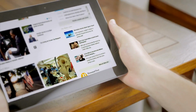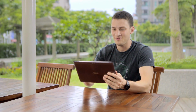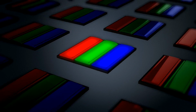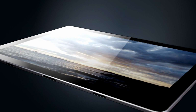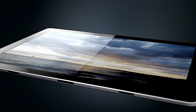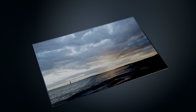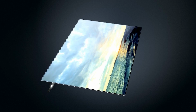Naturally, we wouldn't consider a tablet mobile unless its display can thrive under all light environments. So we turned our attention to the brightness factor. Each pixel is surrounded by a black matrix, which does not transmit light. So when we tried using more than twice the amount of pixels than on the earlier Transformer pads, the brightness decreased dramatically. Undeterred in our efforts to ensure that the Super IPS Plus delivers the brightest viewing experience possible, we increased the amount of LED backlighting.